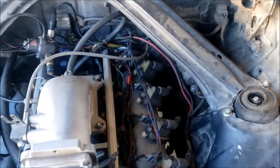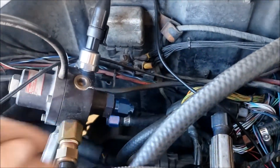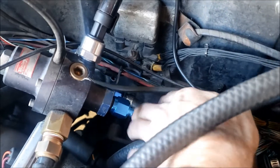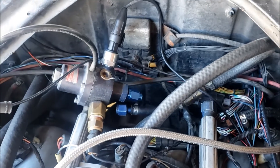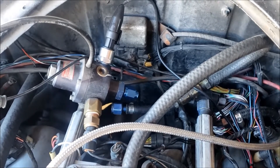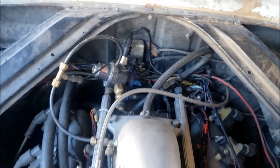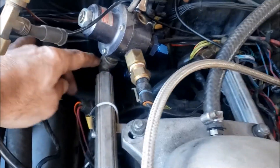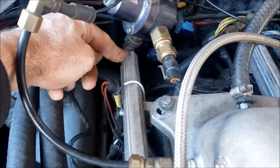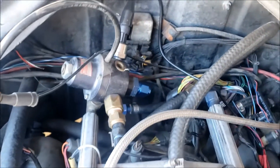Here we are on the engine side. The fuel pressure sensor is up top like before. I put a cap on the output of the fuel pressure regulator. The return line from the tank is just kind of hanging here — I need to pull that fitting off and cap it because it was smelling like fuel. As you drive it, it sloshes around, you get a little pressure in the tank and it pushes fuel up. The temperature sensor is going to get shoved straight into the back of the fuel rail, which has to be better than what it's doing now since there's no fuel flow through it at all.